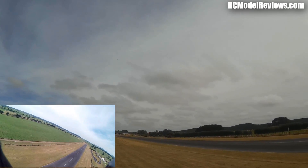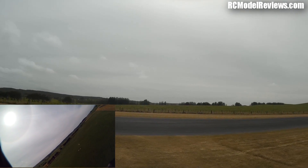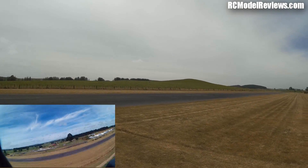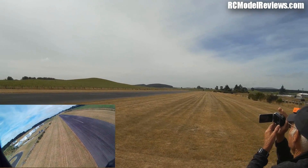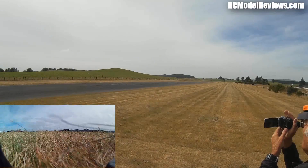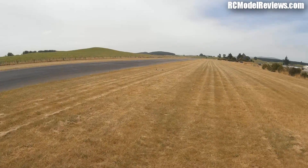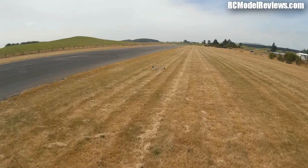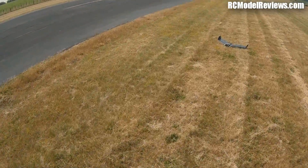The motor just cut out. I'm going to replace the ESC — it's just not good enough. Other people have had problems with the ESC and I can see why now. It's cut again. I'm not going to try again — we'll do a short landing on the grass. The ESC is crap, and it needs a huge amount of up trim. I might be able to move the CG back a bit because with all the up trim I can get on the transmitter it's still not enough.